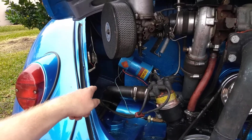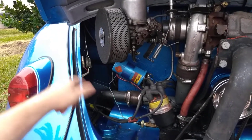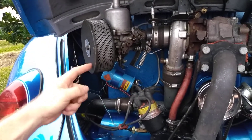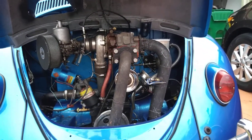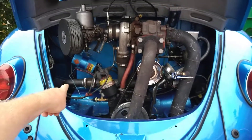We'll see if that works — hopefully it'll crush and seal. I haven't started it up yet to check. That's obviously where I'm losing manifold pressure, which is why you see a boost spike: it builds up, then starts spewing out, and comes back down. If we can keep it at ten pounds of boost instead of six and a half to seven, and go on a little diet, I think we can get in the 1350s without doing anything too wild.